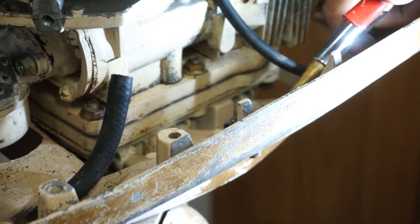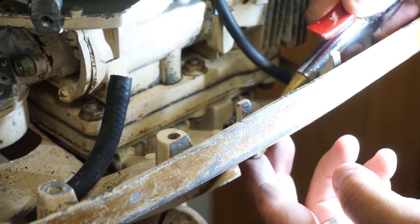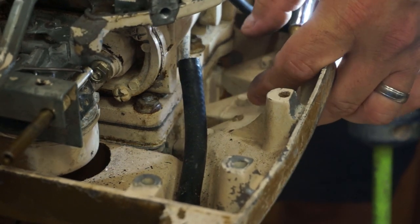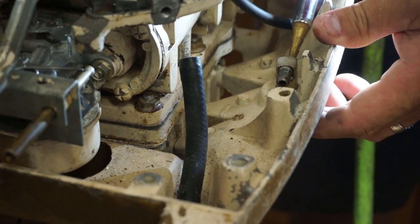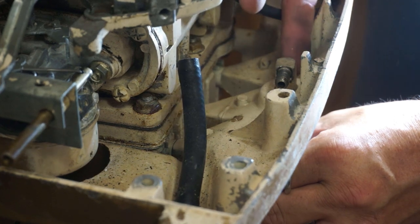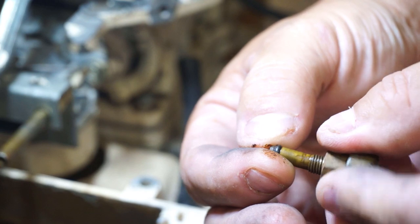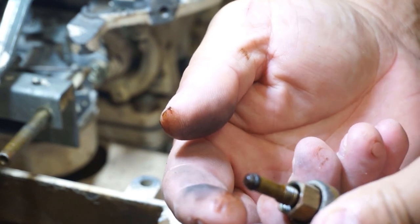Now I'm going to see if we can get some air in here and blow it out. Just blowing air through one side to see if it's coming out the bottom and up the top, and I think I'm getting a good flow — I can see it coming from the bottom. Here's the cutoff valve, and I think that's a little O-ring right up here. Let's see what we've got in our stock — maybe we can replace it since it's hard as a rock also.